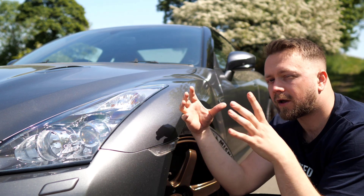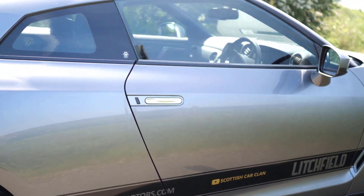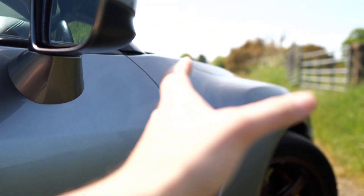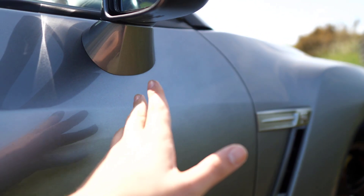From the DBA onwards it was less common, because they actually fitted bigger discs to those cars. Just in case any of you are tempted to click off early, try and get your hands on a 2011 onwards DBA car, mainly because of the changes that were made in the gearbox — we'll talk about those in more detail once we get the car up on the ramp. One other thing to mention regardless of the year: check for corrosion underneath these mirrors, which tends to congregate just about here. There was a theory it was due to mirror flexion at higher speeds allowing moisture under the paint — as to whether that's true I don't know, but they can definitely corrode around about here.